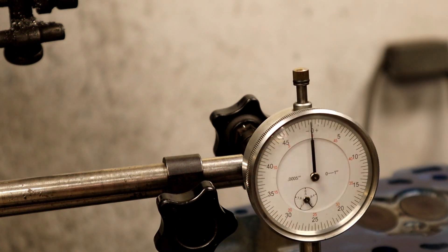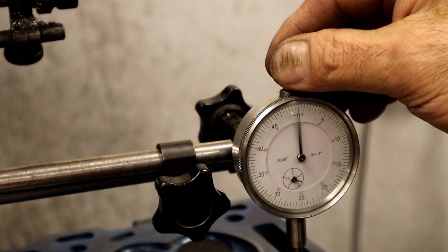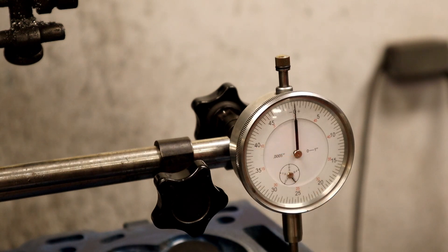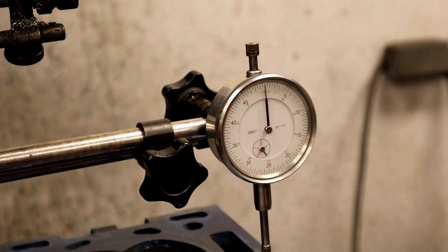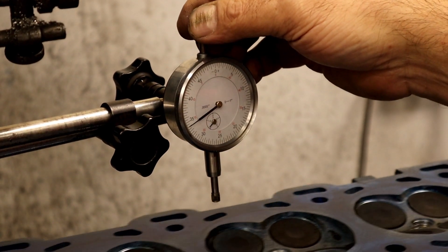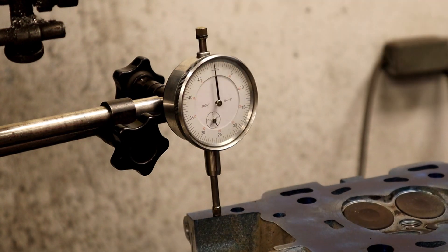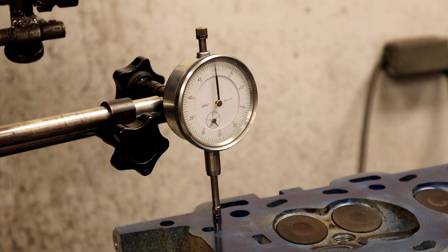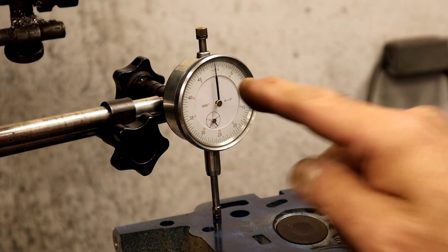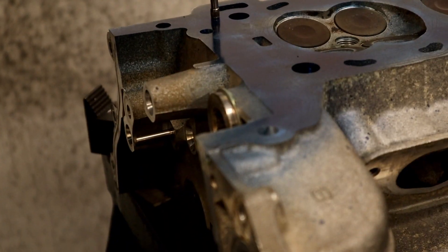I can take it wherever we need. Zero over here — you see that? Zero. We can go all the way over, any spot on the cylinder head we want — zero. What we normally want is the four bolt holes at the end. If you take Scotch-Brite to it, it's going to be all over the place, but we've got our four bolt holes at zero. We have a perfectly flat surface now, within zero. I'm going to do maybe a quarter of a thousandth — just a light skim — so that we can see what the deck looks like. We know we're all at zero, so it's not like the machine was angled wrong. Let's go ahead and start milling.